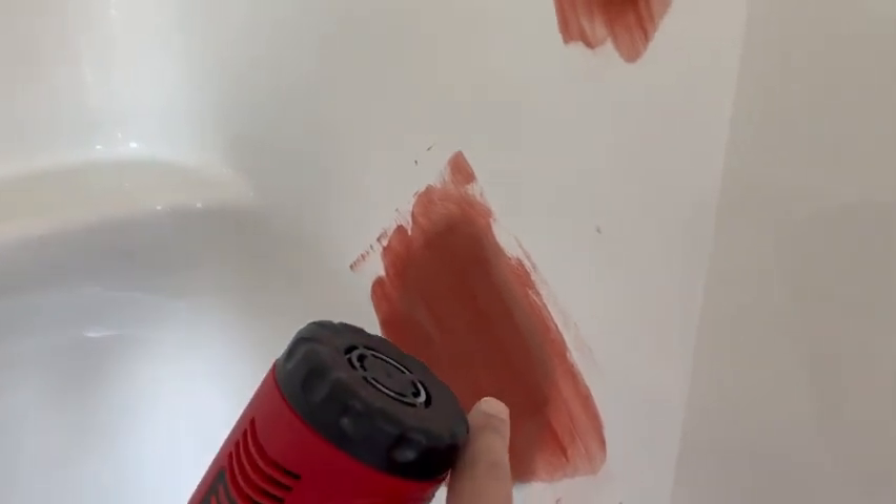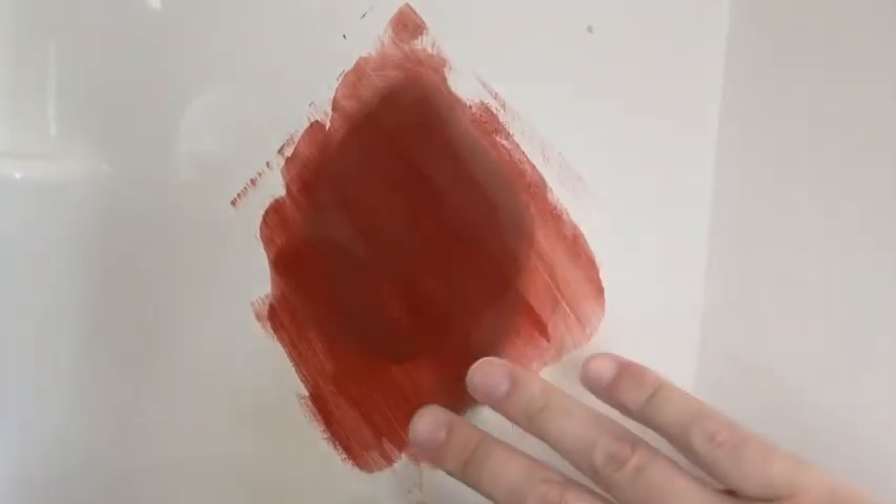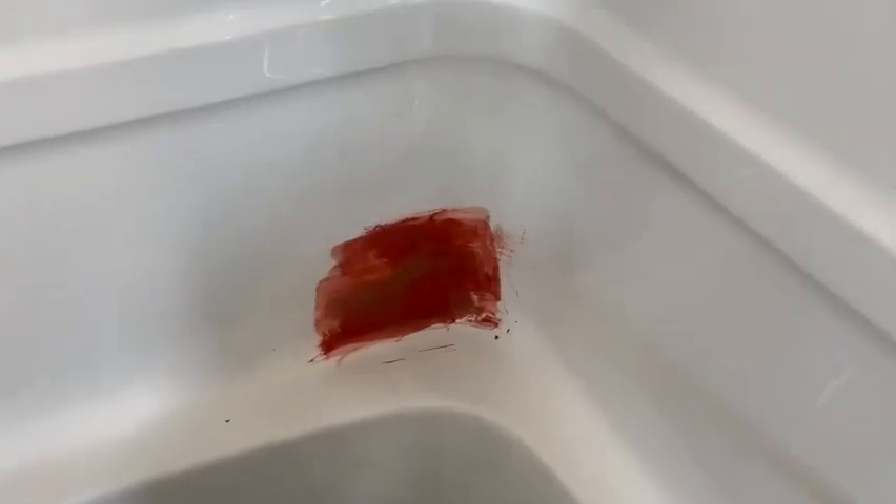Here we are in the front, putting the first coat of red on. This took three coats. The way I like to do my body work is I put just enough to fill the hole, then my second coat I put just enough to fill that hole again until it's basically completely flat, then I do one more skim coat of the green. It's very minimal sanding — I don't like putting it on thick and then sanding a bunch off. It takes a little more time mixing but way less sanding, a lot cleaner, no Bondo dust piled up everywhere, and it's faster in the end.